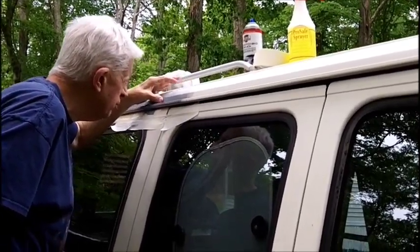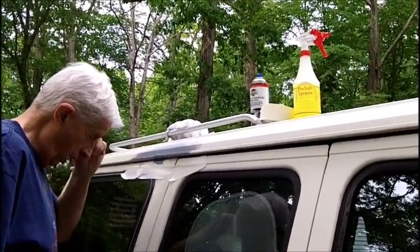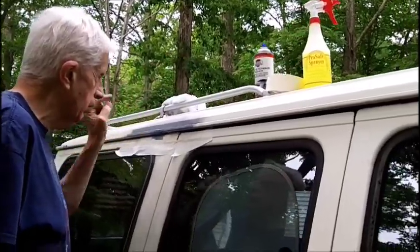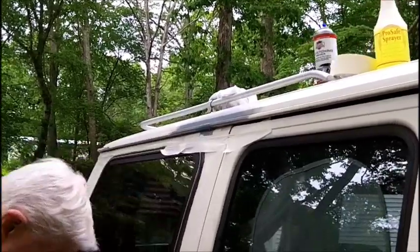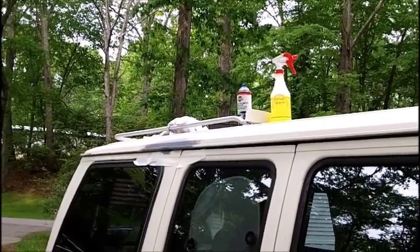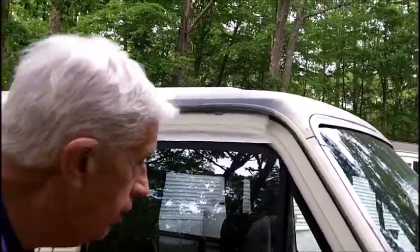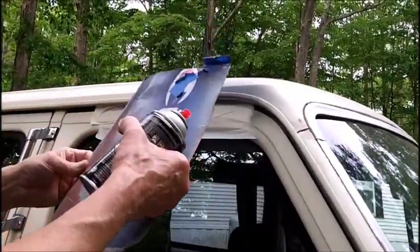It's dry, but it turned crinkly. It turned crinkly with the self-etching primer on that Rust-Oleum, but it didn't do it over there. So I think when that dries good, we'll hit the 220 on there and then just put this on, and that'll be it. That should do it. So let me check the dryness. Oh yeah, that's totally dry. All right. Now.